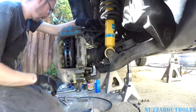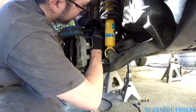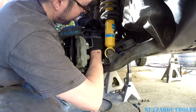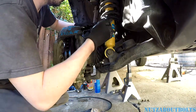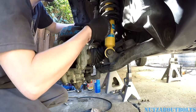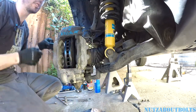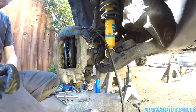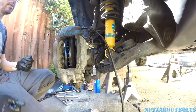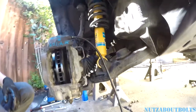The rubber's starting to crack — probably should change these. But we need to finish this video, so I'm going to do that first. I'm going to tighten that down and look at this bleeding process going here. I've got more to do, so I'm just going to do the gravity bleed type of deal — there are the bubbles coming out.